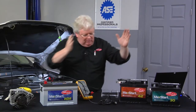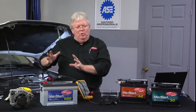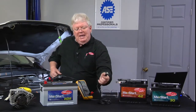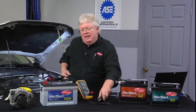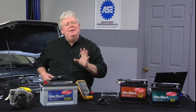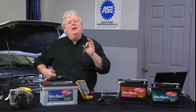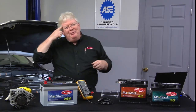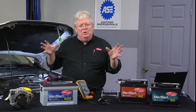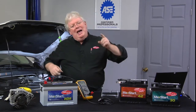But if I'm doing wrenching on the 12 volt battery or anything else on the vehicle, I have potential for a short. Here's the good news though: this may have a lot of juice from the boost box, but it goes to pins 16 and four. Pin 16 is typically fused with a 10 amp fuse going to that DLC power source — basically to run your scan tool. So if you have a brain freeze and short something out with a wrench, at the very worst you're going to have 10 amps of current flowing through a short circuit, popping the fuse before any major wiring damage occurs. And I like the sounds of that.